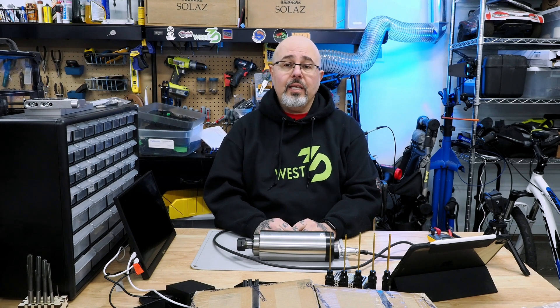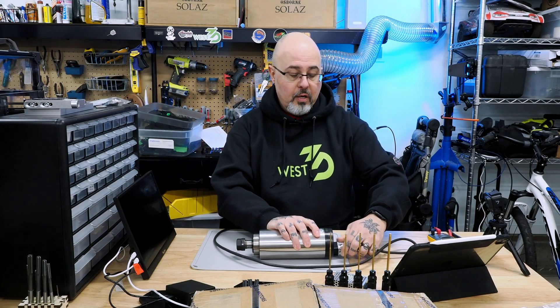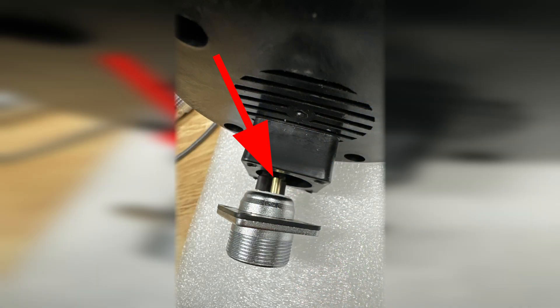What I had to do was take a short piece of 18-gauge wire and put a ring terminal on the end. I removed the plastic cover — just pulled it up a little bit; you need to be careful because your motor wire does sneak through there. I pulled it back and saw that there was nothing attached to pin four. So I took that 18-gauge wire, attached a ring terminal to one end, and sandwiched it between the plastic case and the metal case where one of the screws goes, then soldered the other end to pin four. Now this is safety grounded, so if it does short, that voltage has a path to go directly to ground and not through you into the floor.